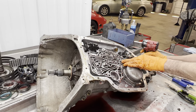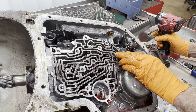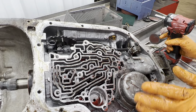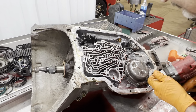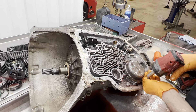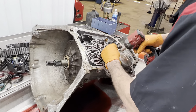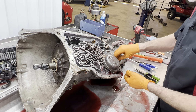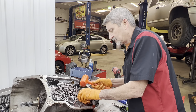Now we do have our center support bolt here. We have a reverse clutch ply, third gear clutch ply, and we have a lube circuit going through. They have a funny bolt in there and it looks stripped. The valve body gasket being on wrong will burn the tranny right up, especially something with the Cummins — something like that heavy.